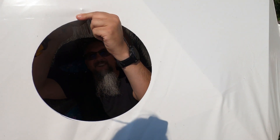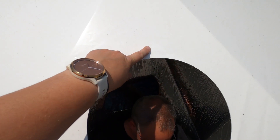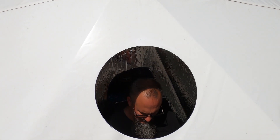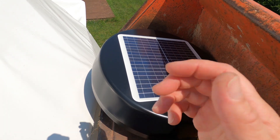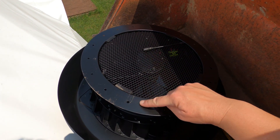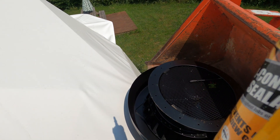Put your silicone on. We need to start making the holes — we've tried drilling all the holes beforehand and it has never quite lined up properly, so we've given up with that to save us a bit of time. Basically, you need three rings of silicone: one on the inside, one over the holes, and one on the outside. So I'm going to give that a go now and hope my silicone is still alright.